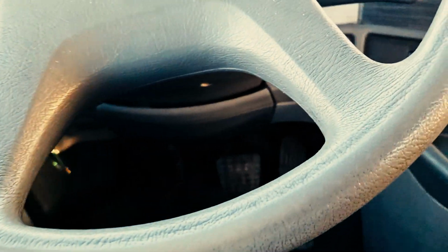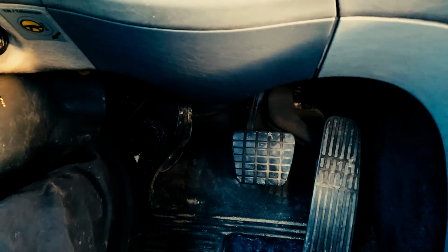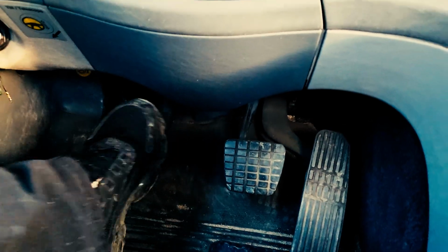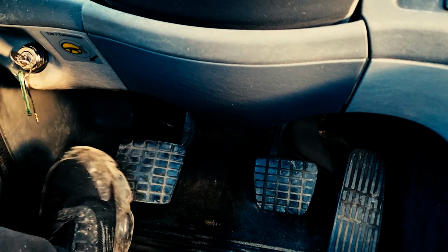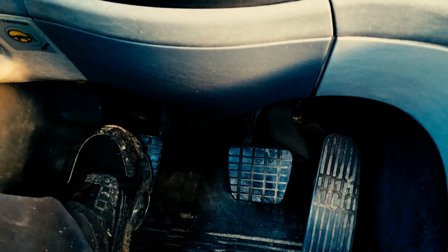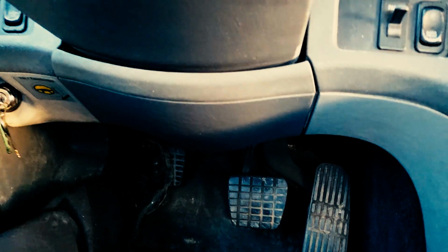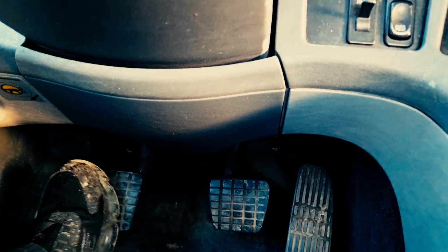You're going to put your clutch pedal all the way down to the ground. And in this case, this will be the only time you will be doing it, if you're parked or stopped at a light. Other than that, you will never engage the clutch brake, which is all the way at the very end. You got your clutch pedal. You got free play. Nothing's happening right there. As soon as I feel some pressure, normally to switch any gear, you only need to go about 2 to 4 inches the most to switch the gear, but never all the way down to the floorboard, as if you're in a POV.